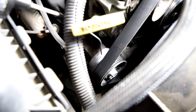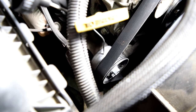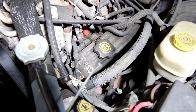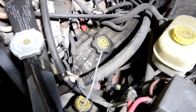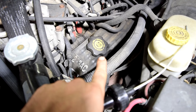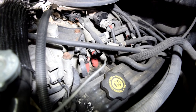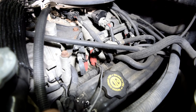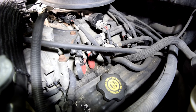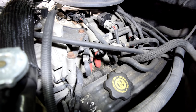If you were suspecting the noise coming from your tensioner, you could get the stethoscope down here and get it on the back of the tensioner itself — that's a good spot to check, though it's going to require you being very careful and having pretty steady hands. Or if you were suspecting the noise from your top end or your valves, you can get this on the valve cover, or on this car you can just take off the oil cap and if you hear the noise more, you've narrowed it down to that top end side. Also if you suspect a fuel injector, you can use this to listen to them ticking and compare all of them — the one that's really loud could be the culprit. Or you can just disconnect the connectors for your fuel injectors and if the noise goes away, you've narrowed it down to whichever fuel injector you just disconnected.